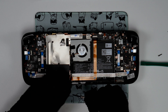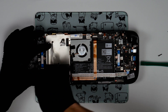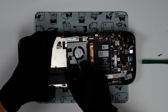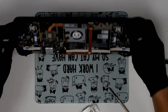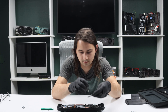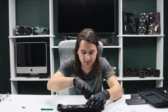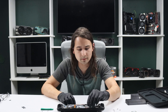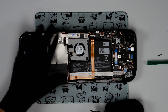Just put it back together. Tighten the three screws holding on the metal shield. Don't drop them — having a magnetic screwdriver makes this a lot easier. Make sure not to leave any screws inside of there; they can short and kill your Steam Deck. Now we've got our three screws back in this little cover. Go ahead and fold the aluminum tape back over so it's nice and flush.